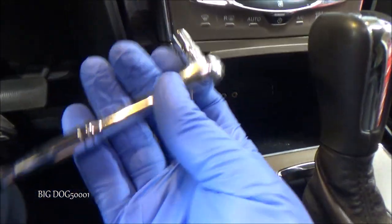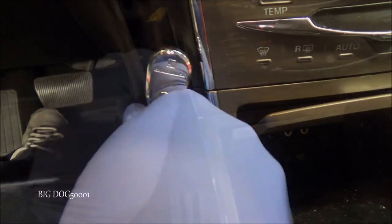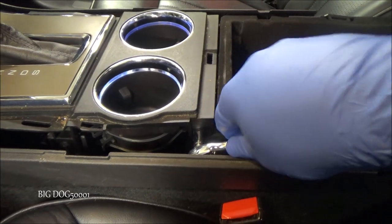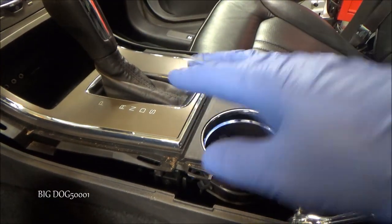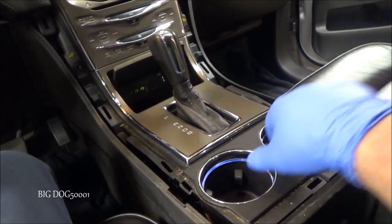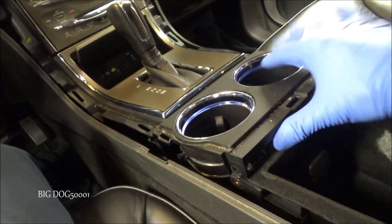Using a seven millimeter socket with a quarter inch ratchet, we'll just go ahead and loosen these up — and that's what they look like. For these down here, I'm just going to pull this back and loosen them up. I'll do that for all of them on both sides, and then we'll be ready to get this out. It's pretty easy just to pull that back — you can easily reach in there with that quarter inch ratchet and get these out.